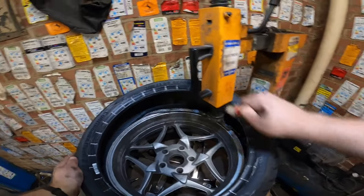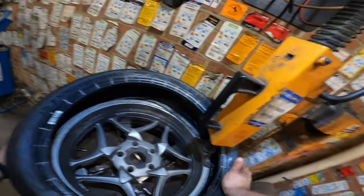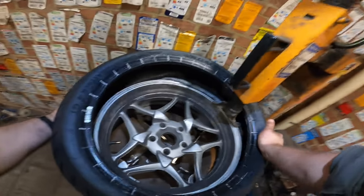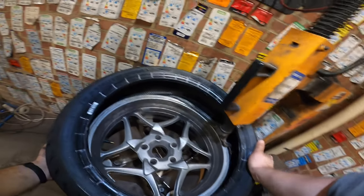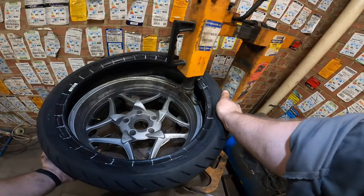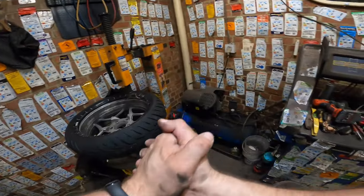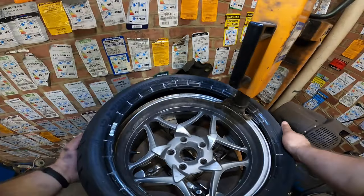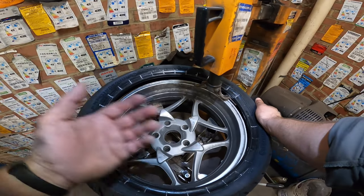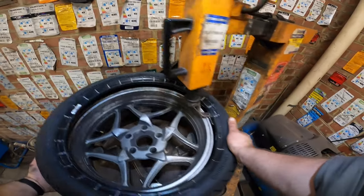Voila. It's very hot, so the water is evaporating quite quickly. Yep. Go a little bit, a little piece at a time. And as you can see now, the tire almost pops on by itself. All right, now by this time you want to check out your direction again, as you can still take it off if you need to. Okay, arrow is good. Nice.